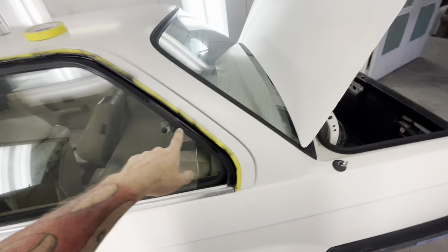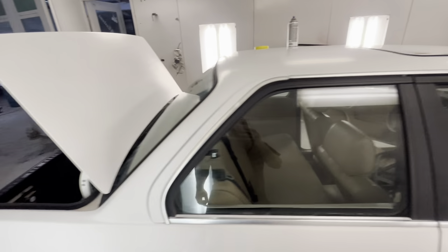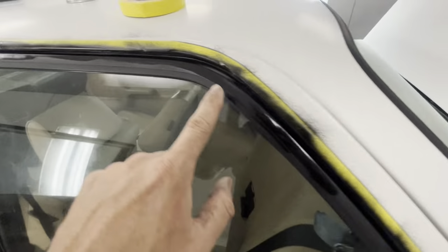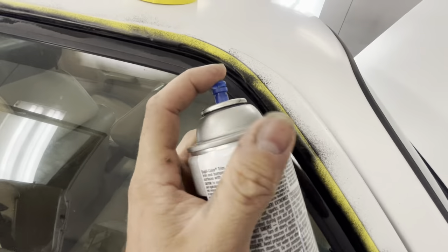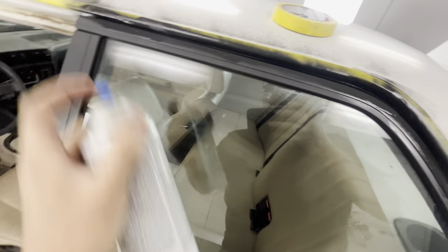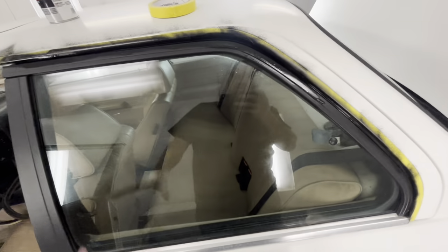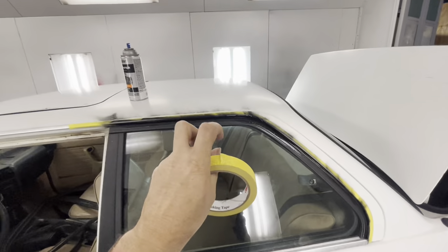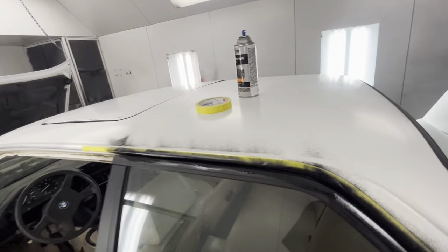On the movie part of things, we've got to get that white out of there, but you've got to do this fast — we don't want to sit here and tape this up perfectly. On this side I just noticed there's a black seal inside there, so there's actually supposed to be a black seal. All I've done is put some tape on the chrome trim and just take some bumper paint and blast it up in there. You're going to run it, you're going to get it all over everything, but it doesn't matter — this is movie work. It just has to be on screen for a couple of seconds or a minute or two. We'll paint right over top of all that spray paint, and plastic will cover the window. That's why I really like movie studio work — because it's hack work, and I absolutely love hack work.